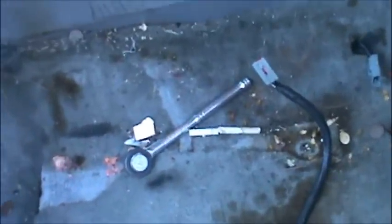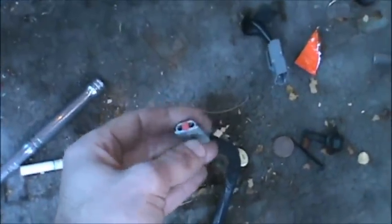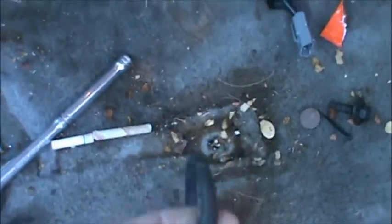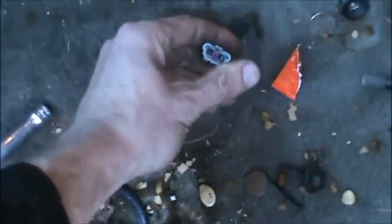And there's 2 plugs on this specific car. This is your supply and your ground from your electric seats. These 2 supply lines right here. And this one right here goes to the seat belt, I'm pretty sure. So you just basically unplug both those.